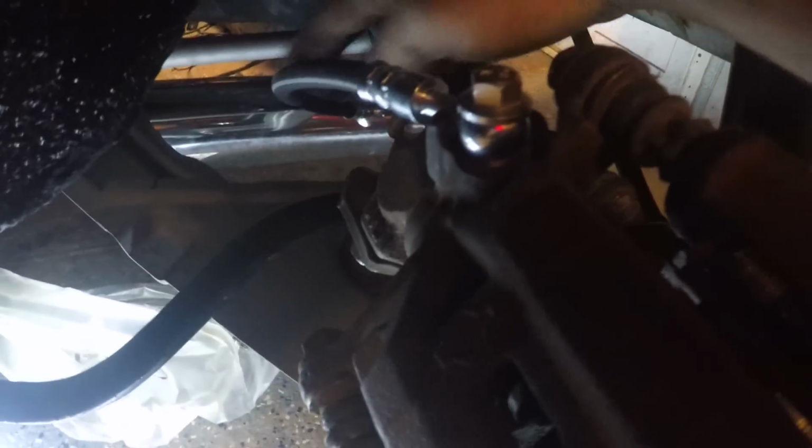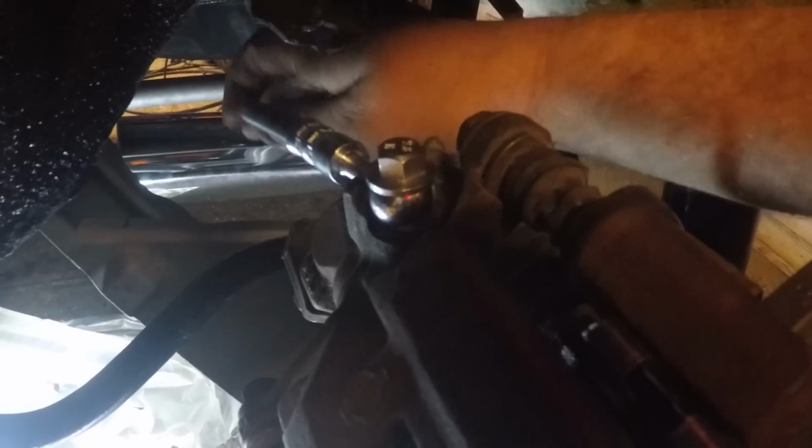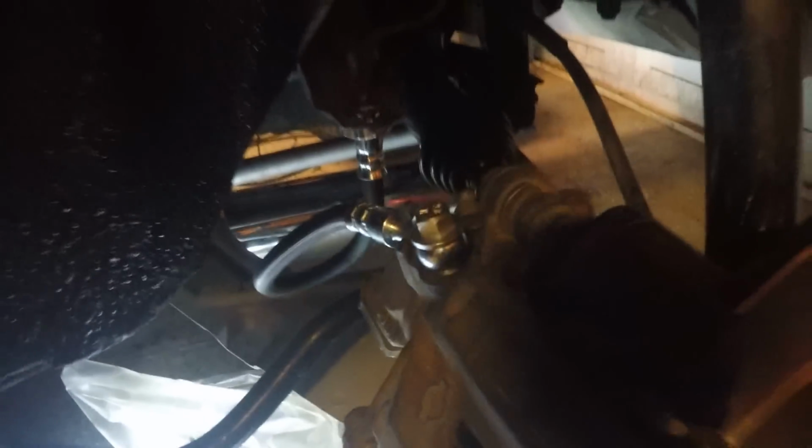And the brake hose is a 240SX just off the factory car. I had to order new ones from AutoZone, direct from the vendor, so you have to prepay and all that. I'm sure you can find them on Rock Auto and stuff, but I didn't feel like waiting. It will slide into your factory mount here, and you can put the little clip back in for it. And I had to get the banjo bolts. In case you're looking for them locally, they're an M10 by 1.0.